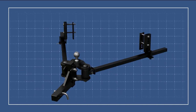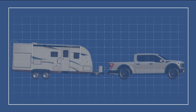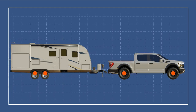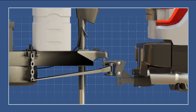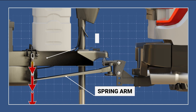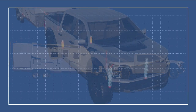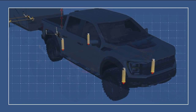While there are many systems on the market, all work the same way. They distribute weight from one point to many, leveling the combined suspension system of a towing vehicle and trailer. Most weight distribution hitches use spring arms to pull downward on the drawbars of the trailer. This creates lift at the coupler, leveraging the weight of the hitch load off of the towing vehicle's rear axle.